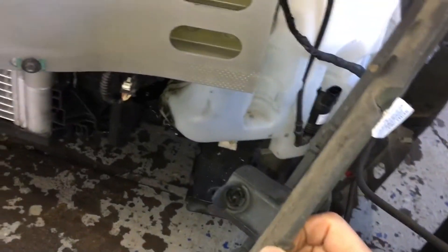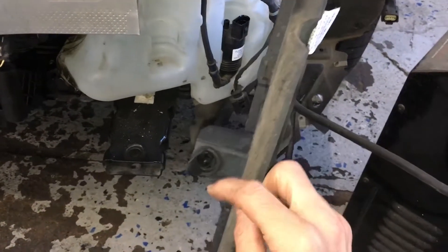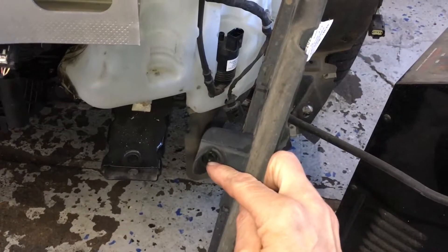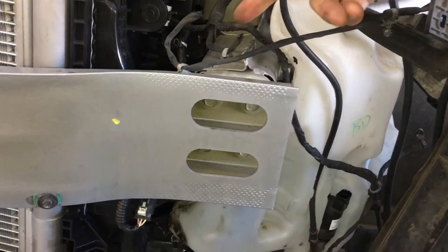After an accident, if a car runs into your shop for repair, for a recharge, after you do the recharge, look for the air temperature sensor. They get broken, they get left off sometimes, or after a collision it could have gotten damaged. That's this case right here.